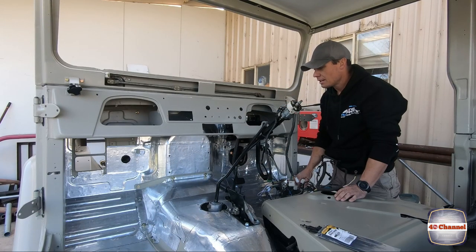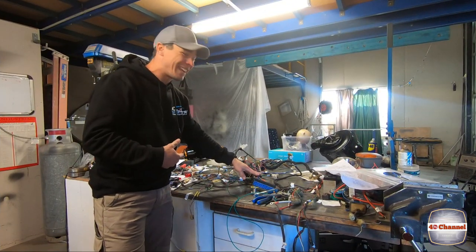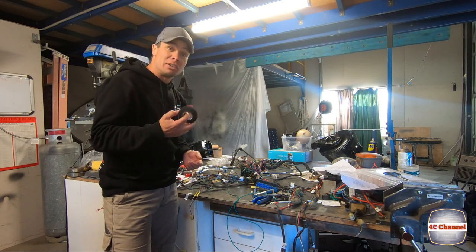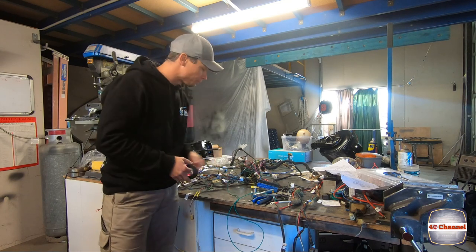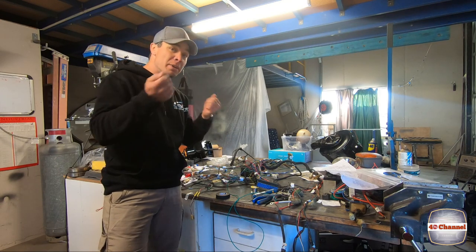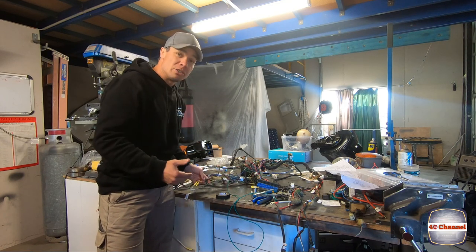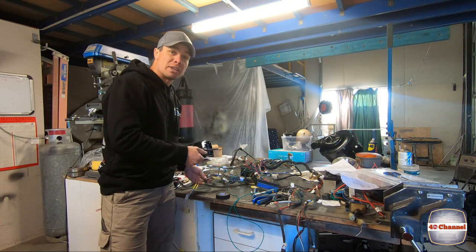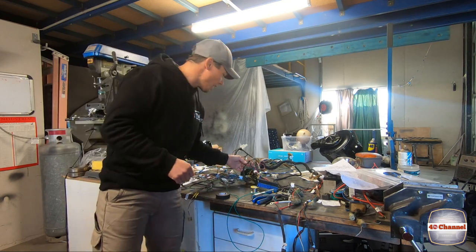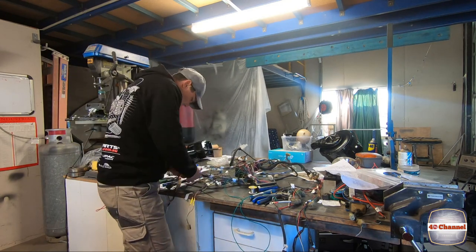Deja vu, I think I've done that before. Right, the wiring loom's back out of the car again, so now we're going to wrap it all up in this fleece tape. I really like the look of this stuff, it looks pretty cool, gives a nice finish. On top of that we've taken Ian's recommendation - while I was in the car I was able to pull every bit of tail out that needed to go, the plugs and all that, cable tied it all up. So all I need to do is as I wrap it with the fleece tape, when I get to a cable tie, cut it, throw it away and just keep wrapping. Great tip, I really appreciate that.